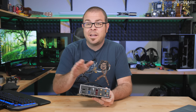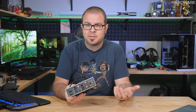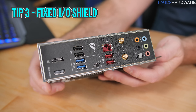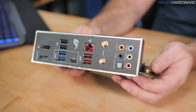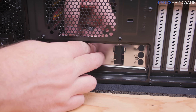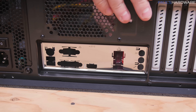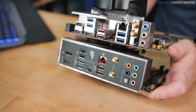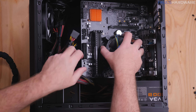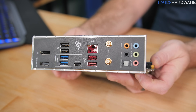Now the next three tips on my list save way less time than those first two, so let me know in the comment section if you guys can think of anything better. Tip three is a newer feature that you can take advantage of: a fixed motherboard IO shield. I think this is a great feature that's appearing on more and more motherboards these days, and while typical IO shield installation is usually pretty quick, it can be fiddly, especially with cheaper flimsy metal shields that are prone to cutting you. Also, if you forgot to install your IO shield, fixing the issue requires removing your motherboard — you might as well just build your entire computer all over again. Fixed IO shields are rad.